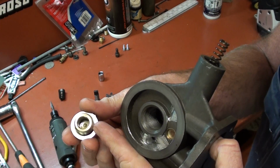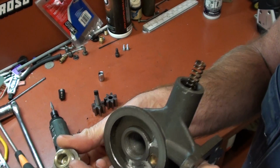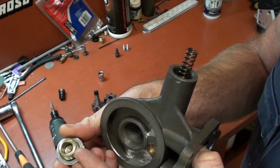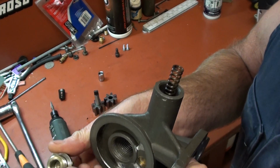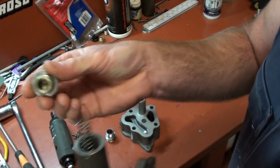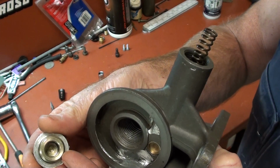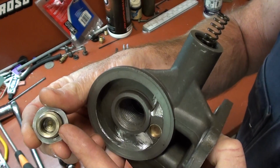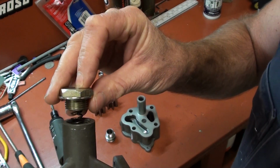He reckons around 100 thousandths of an inch, right? What that does is put a bit more pressure on the spring, and it increases overall oil pressure. He said you can get it up to around 70 to 75 pound in the top end of your engine revs before it releases. So that's another little thing I've got to do, just make up a little packer, about 100 thousandths, no more. Some people say 60 to 100. That'll lift the oil pressure a little bit in the top end.